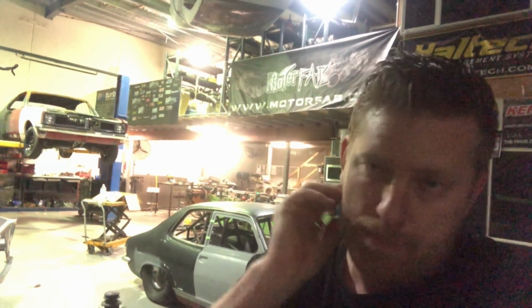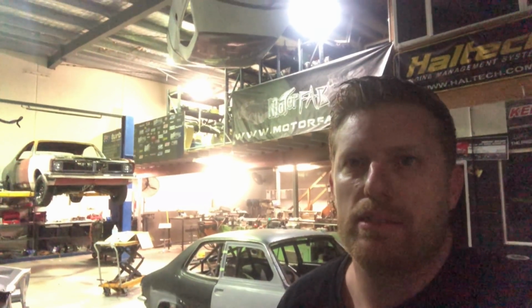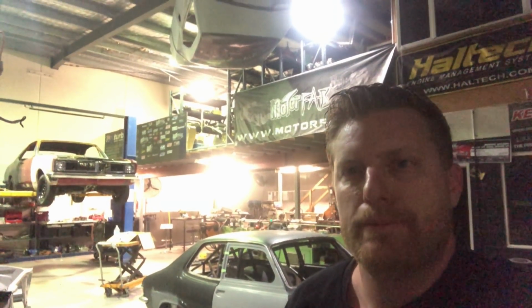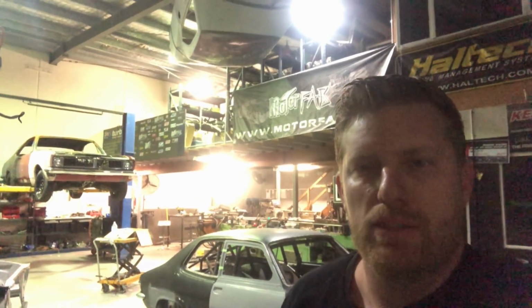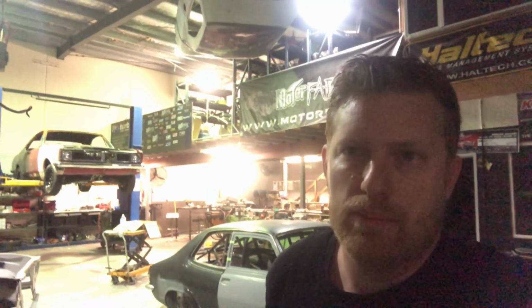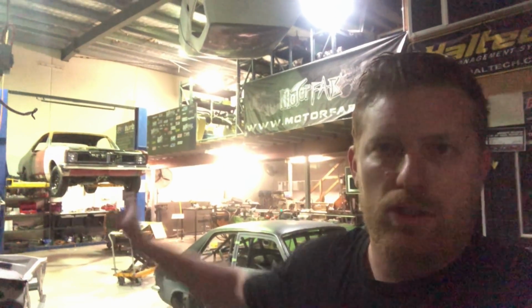I still try to run really conservative on my tunes, like I'll explain later. I've never torched a head or blown a head gasket out even on any of my tunes, but not to say it can't happen, so touch wood, I haven't yet, but I try to be conservative and not lean on stuff too much. But doing what I'm intending on doing to that 454 with a stock bottom end, it is going to be leaning on those particular parts, so it needs every bit of help it can get to survive. So the tune's got to be right. So for the tune to be right with that nitro setup, without EGTs, we need to be able to read the plugs relatively easy. So we've got to try to make the pipes, which are already tight in the circumstance of a big block in that car, but we've got to try to make them so I can read them. But that's me rambling on. You'll see more of that later.